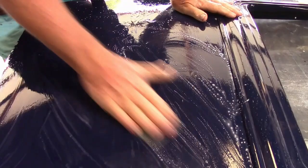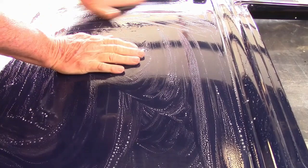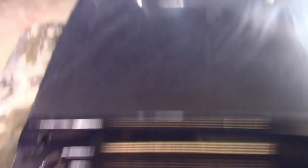And that's done. Next step is to sand and polish the paint. This is a few weeks later, and I'd like to point out that even though the paint is catalyzed, it takes a few weeks to fully cure. Waiting that long to sand it makes the paint harder to sand, but the shine will last longer. He's using 2000-grit paper and using dish soap with water as a compound, which makes it easier to sand and will leave a smoother finish.